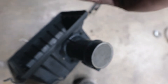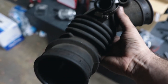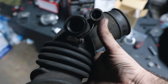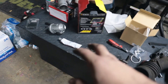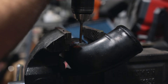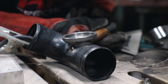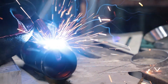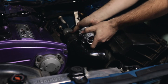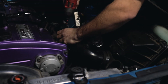I have some bad news — I don't have a coupler that will fit the MAF on this side. Even though I can make the adapter to have the filter work, I don't have a coupler big enough to go from here onto the actual intake pipe. So I'm going to have to reuse the stock pipe and just block off these two holes. I already have one blocked off and I'm making a plug for the other. That really sucks, but at least we'll get the blow-off valve and catch can set up.